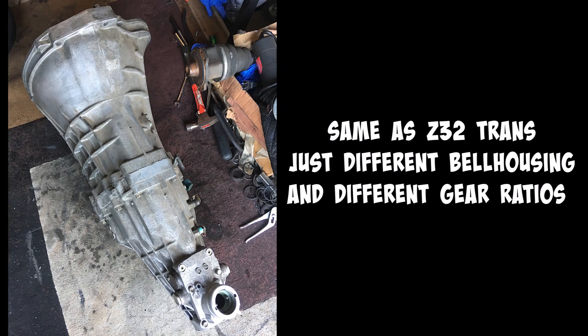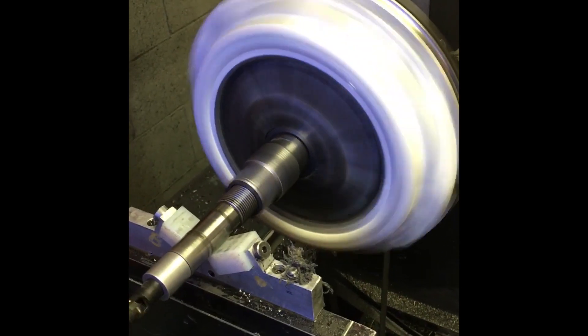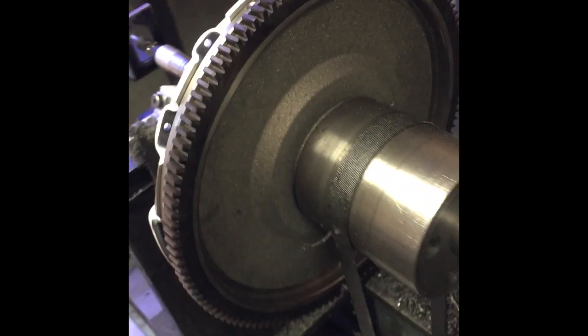That about does it for the motor. On to the drivetrain. For a transmission, I went with an RB25 trans — the rear-wheel-drive trans. There's a White Bunny clutch kit that I kind of Frankensteined. I bought the comp kit, so I have the flywheel from the comp kit, but then I upgraded the clutch to a Clutchmasters FX400 from a 350Z.